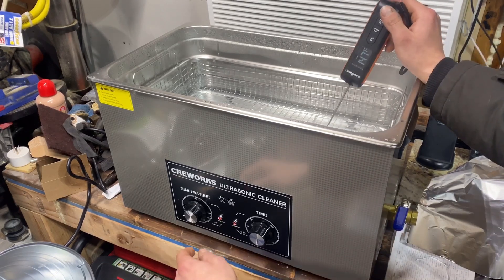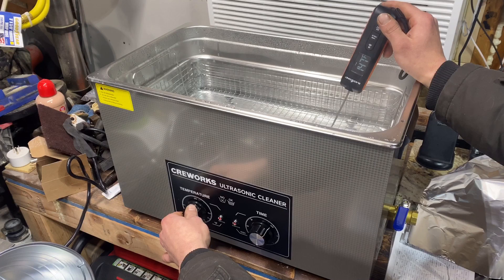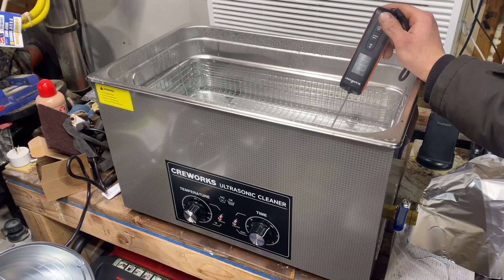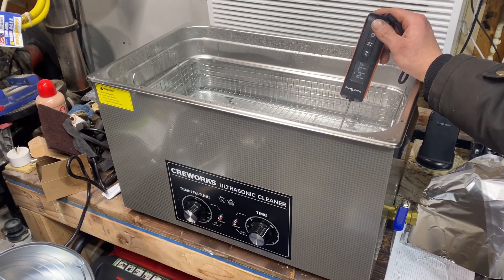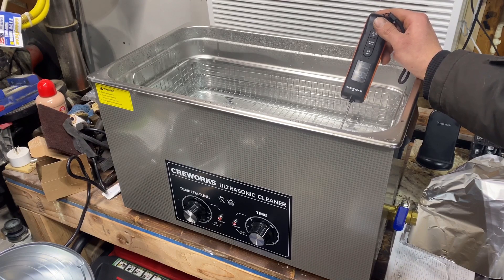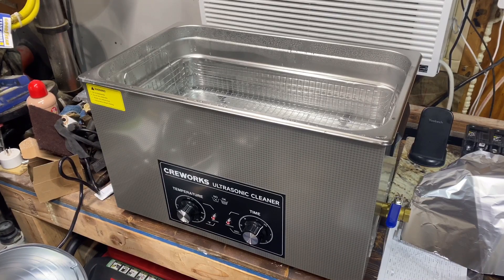I'm going to keep the probe in the water and turn the dial down until the heating element clicks off. Right there it clicked off, and on this dial it's showing the temperature is set to 105 — but when it clicked off, we had 147 on our probe. The click back on is only a little bit from there, probably about 110 on the dial. So first strike: the temperature on this is not accurate. Be advised if you're using this and set the temperature, it's probably hotter than indicated. I don't know if that's because the thermocouple is measuring away from the basin or if it's just what we'd expect.